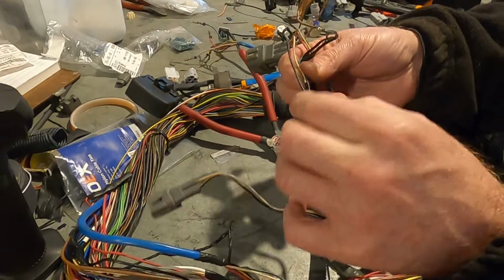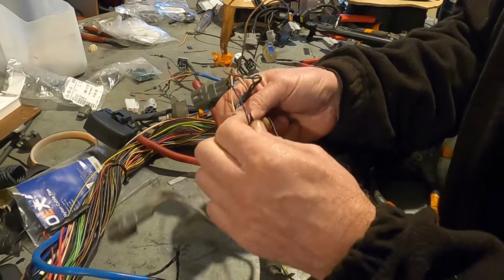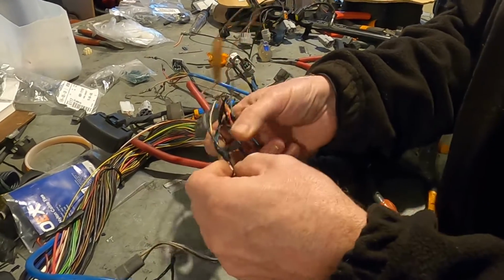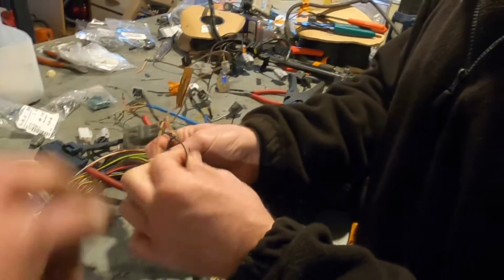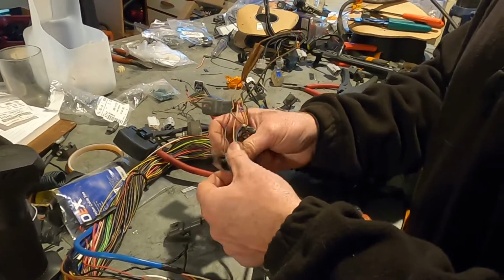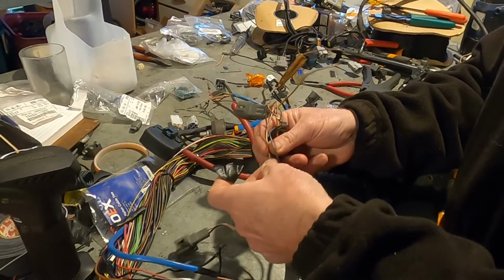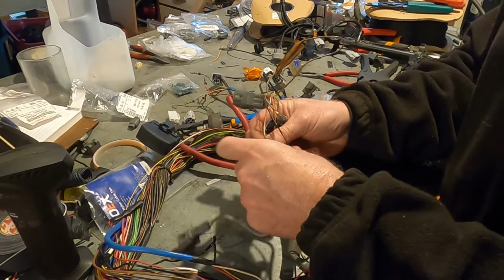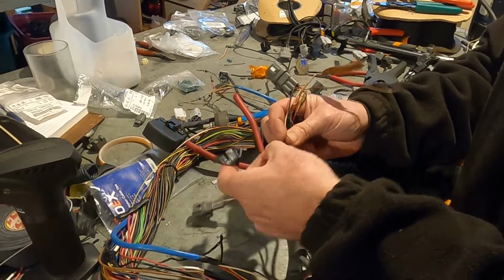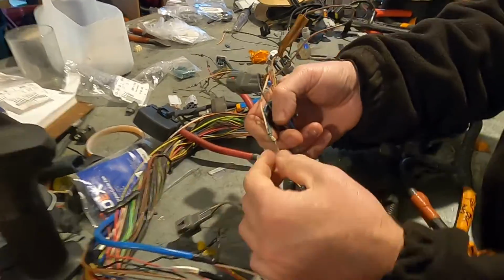So why is there more separate up there? Why do they run them separate back to the ECU? Yeah. Just the way Toyota did them. Okay. But this is a separate loom, so maybe this was an afterthought compared to that. They're joined in the ECU anyway. So if I continuity tested the ECU, they should both be just as they're joined. Yeah. They're joined at the ECU. So they ran two wires, but there's only one connection anyway. So then they join up here.